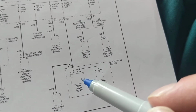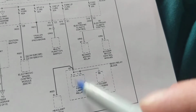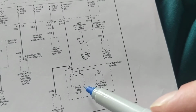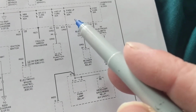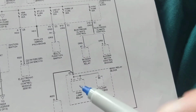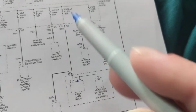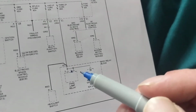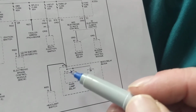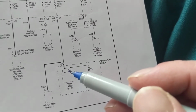There is a relay involved. Pins 3 and 1. One is the control side, one is the load side. Therefore, when we start troubleshooting or looking for the parts, a good place to start is the fuse, then the relays. The best way to do it, like I showed you, is to put wires in the terminals and measure those, like I'll show you in the future, in a couple of weeks.